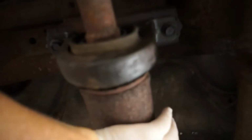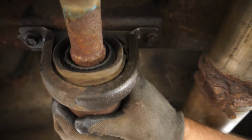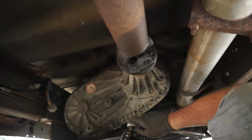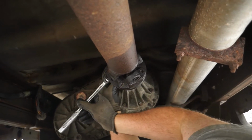There's plenty of room under here. He's got it jacked up, but you can see here the cause of the problem. When I shake this thing, the rubber inside there is just beat up. You see it moving right there when he's shaking it, and that's just gonna blow out on you down the road and beat the drive shaft up. It's gonna beat the fuel tank up. That's some play in it. If those things break on you, they're gonna bust up your fuel tank and mess up your exhaust system that goes down through here. This thing gets to banging around in here, and that's the ball game. Yeah, or it could go up through the floorboard. So it's a dangerous little unit. It's taking all the torque of this truck. So we're gonna go ahead and get the very first U-joint bolts out of there, the ones that hold the drive shaft to the transfer case, and then move on to the next piece.